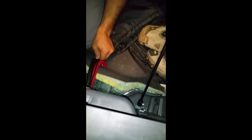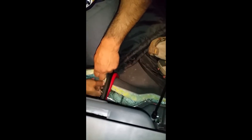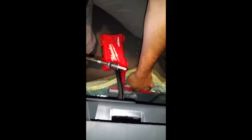You want to come zoom in? Okay. You see that wire is right with this black wire. All I'm going to do is pass it through the hole and connect that wire to one of these bolts right here. Well, come on this side. Connect it to this wire right here. You can see that these are self-tapping screws, and I just use that to secure this onto there. I did pre-drill the holes, however, just to make it easier for myself.